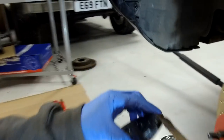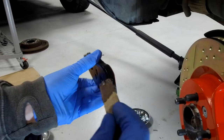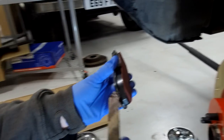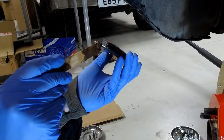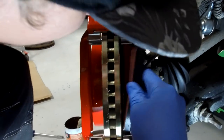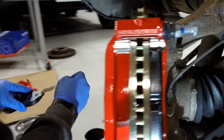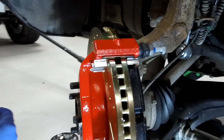While Ian goes to get the pads I'll have a little look at those - you can see they've all fitted in there nicely. Copper grease - a bit on where the pad tabs sit at the edge, because that's where it's going to slide as they wear. You don't want your pads seizing at one end. It will slowly work its way along as your pads wear down. Just go in one end at a time - that's the easy way of doing those. That looks mint on there with all that.